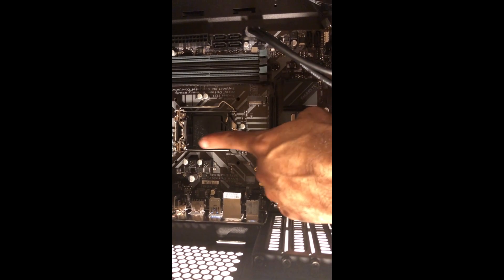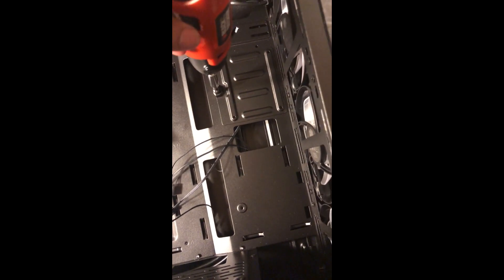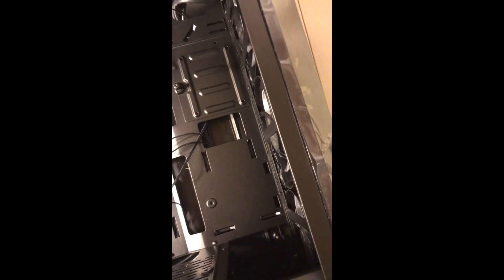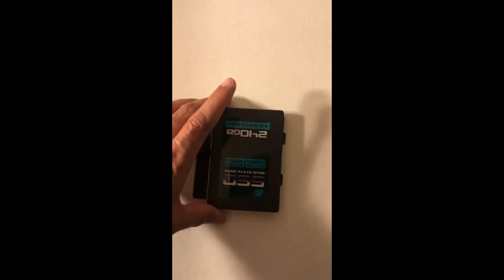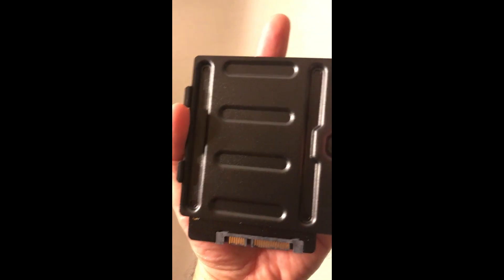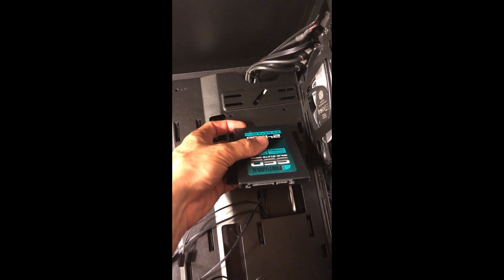After the SSD, I'll install the power supply, which goes right in here. Then I'll install the processor and heatsink fan, then the DDR4 RAM. For the SSD, I take out this drive plate, mount the SSD with the plugs facing down, secure it with screws from the back, and slide the plate back in. The SATA cable and power cable will connect in the back.